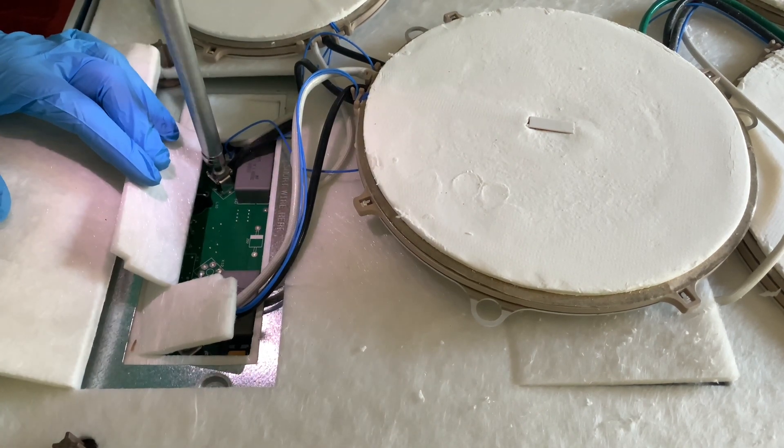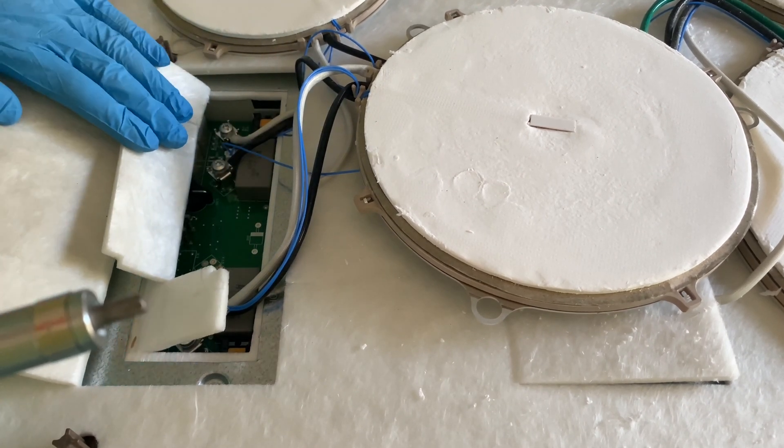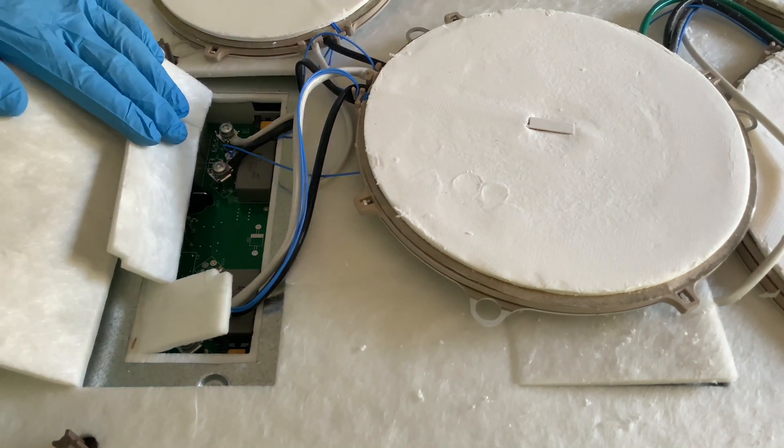You don't need to back out the screw all the way, just a little bit. And then the electrical connector you can just remove by hand. It makes sense to start with the front left element — once it's out of the way, the other ones are easier to remove.